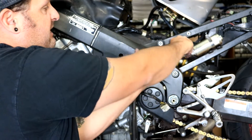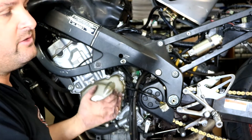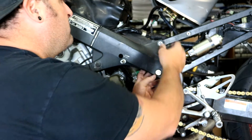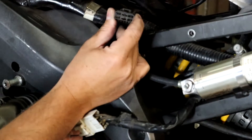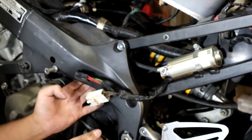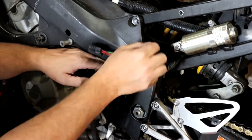The connectors are completely hidden behind this frame rail. You can move stuff around and get to them from above or below — it's not hard, but you have to do it by feel. Here is the battery side of the harness, the black plug, which was connected down behind here to the black plug on the regulator. On the back side, lower, is the stator connector — the white one — which ran up alongside the other wires and was connected behind the frame.